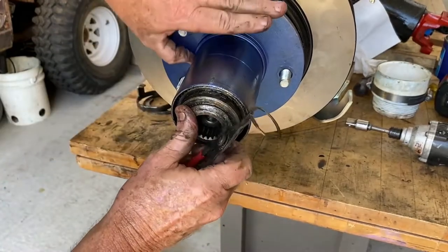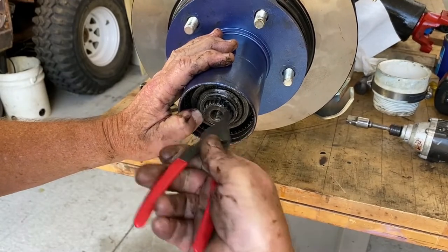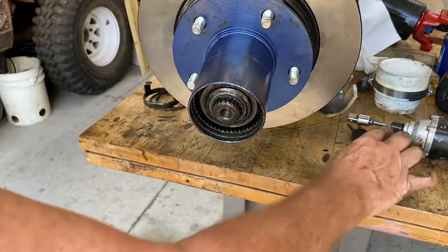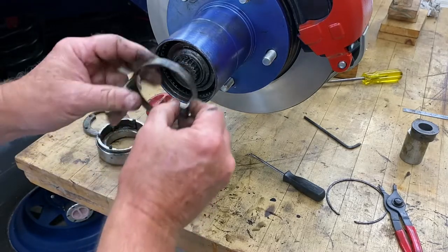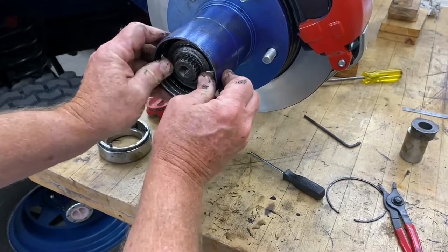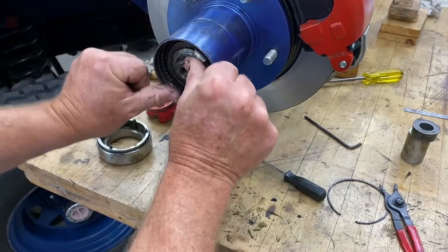The locking hub mechanism needs to go on, then you've got to get the ring into the groove. That's retained in there after you have both clutches in and retained with the ring. Then the actuator goes in — that's what separates those two halves — and the actuator can go about anywhere you want it.